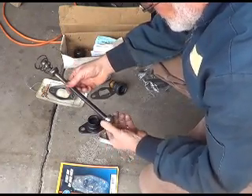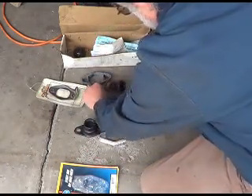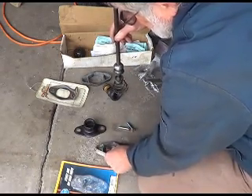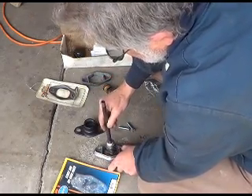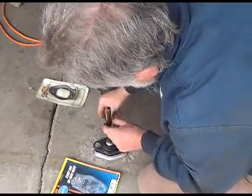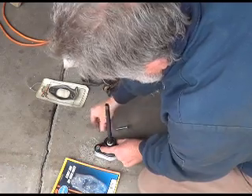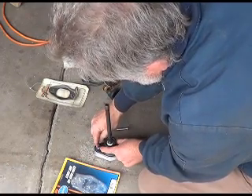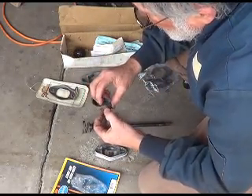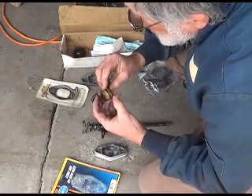The way you do this: take off your shift knob, this slides all the way down, then you're going to take your shift plate — this is spare stuff here for demonstration. That goes on the bottom, that goes on the top, the spring goes in like so, and then it's all captured by this piece. You'll need longer bolts to capture it down into that socket in the tunnel. You want to reuse your washers from your other one. Here's the nylon bushing that was in the car — still in its entirety, but worn to the point where it was a good thing I replaced it.